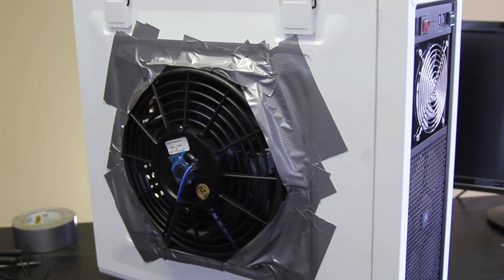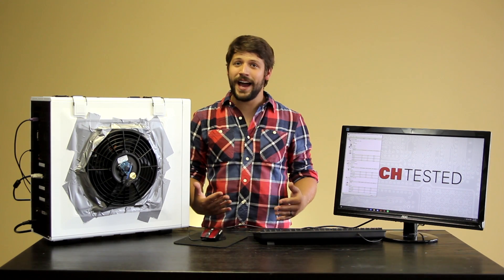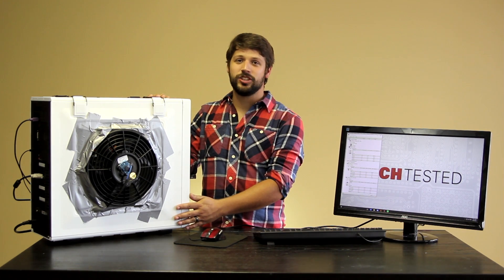While I'm not sure why the CPU was running a few degrees hotter than in our previous test, I think it mostly has to do with the direction of the airflow. Instead of the air running across the CPU cooler, it's just billowing inside the case with this giant fan on the side. While it may be ugly and it may be loud, the big fan did actually bring notable performance gains to our computer. But seriously, this thing is really loud — you have to yell to have a conversation while this thing is running.